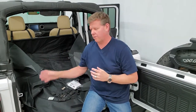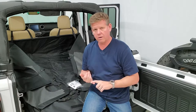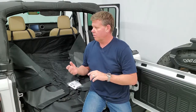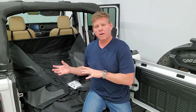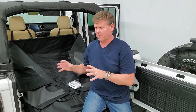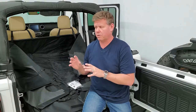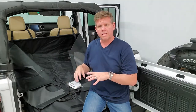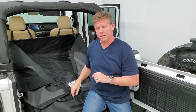The next step will vary depending on the vehicle you have — hard top, soft top, or power top. For hard top users, all you're gonna need is six straps, one shoulder washer, and one flat washer. Those go on either side of the grommet to help protect your paint. You don't have to take your roof off, but you will need to loosen each bolt, put a strap in, and tie the bolt back down. You'll need to get your tool kit out — the one that came with your Jeep.